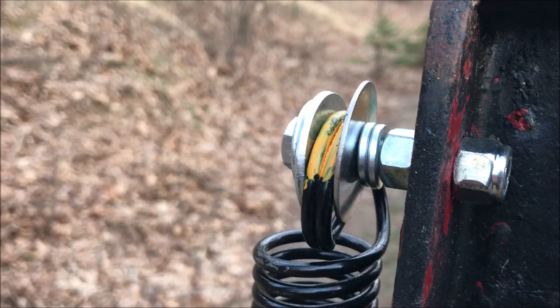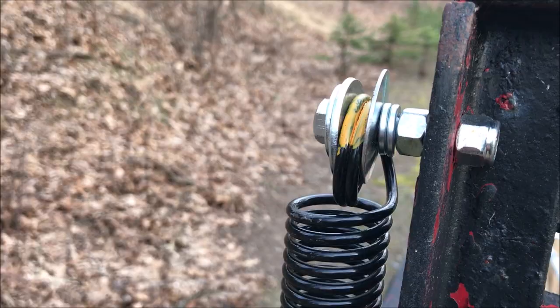These are the yellow top springs — they're good for 130 pounds apiece. Before, when I dropped this gate I just had to grunt to throw the thing up. Now when I set the thing down, it drops in place. It's not like the videos you see where some guys are picking it up with one finger, but holding the phone in my right hand I can now grab the gate and put it up without a lot of effort.